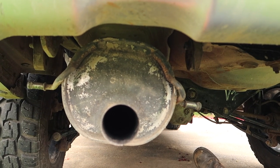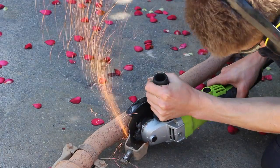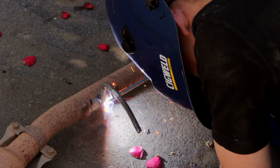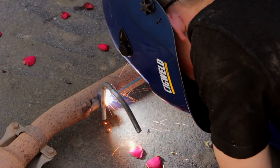Lastly, fit the exhaust. You can use coat hanger wire to secure the two rear hangers to the body as the exhaust will no longer line up. I welded some new hangers on so the wire is just a temporary measure until you get to an exhaust shop. At the very least ask them to fix your exhaust hangers, but you're better off asking them to tuck your exhaust up into the body for better clearance.